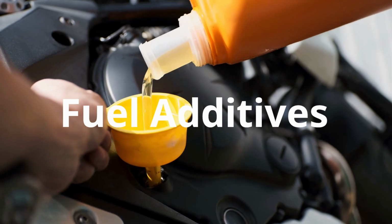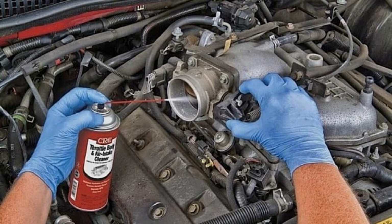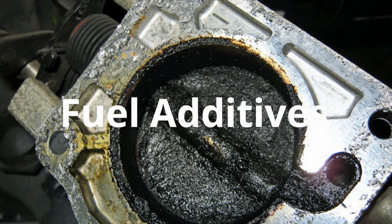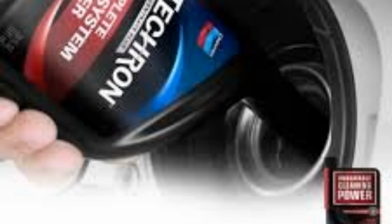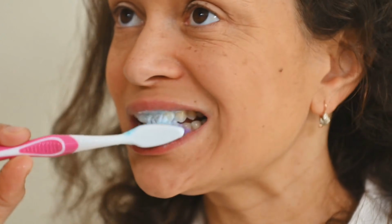Number 5. Using fuel additives. And last but not the least is to use fuel additives. Though this doesn't clean the throttle body directly, it helps prevent future problems. Additives like Chevron Techron, Lucas Fuel Treatment, or Redline can break down carbon buildup inside the engine and help reduce deposits in your throttle body. Just pour one into a full gas tank every 3,000 to 5,000 miles, depending on the label. It's like brushing your teeth between dentist visits, and it keeps things clean until the next big job.